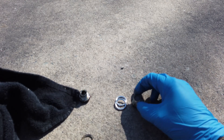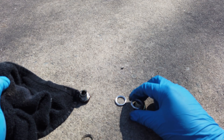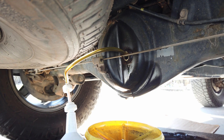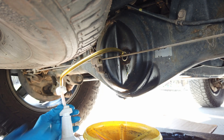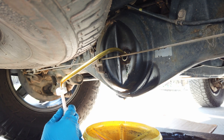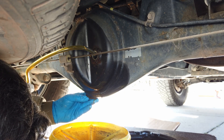Your crush washer has a flat side — that's the side you want on the bottom. I've plumbed the pump kit up to one of our quarts of Redline and I'm running some fresh diff fluid through to get all the contamination out while we have the drain plug out. After it's done draining and after you run about a quarter to half a quart through until it looks honey-clear, we want to put our drain plug back in at 29 foot-pounds. Be sure the threads are cleaned up.